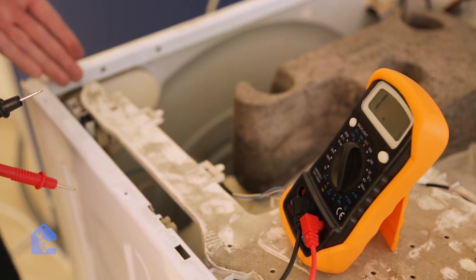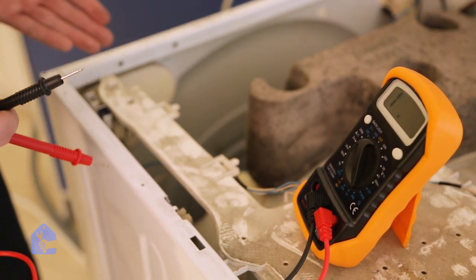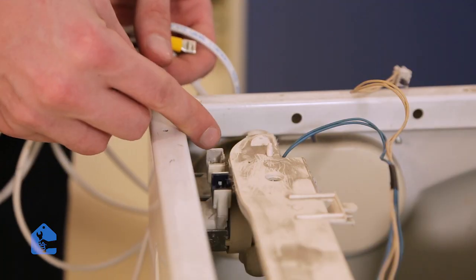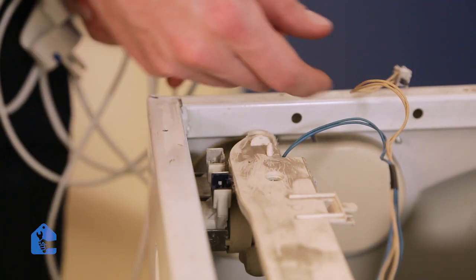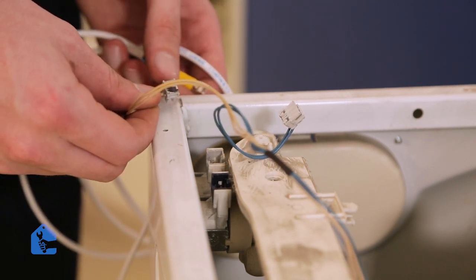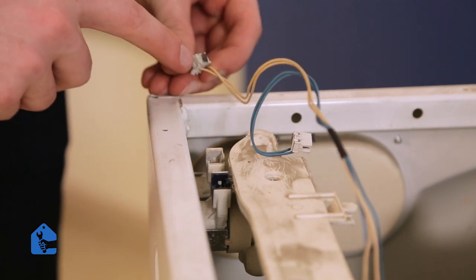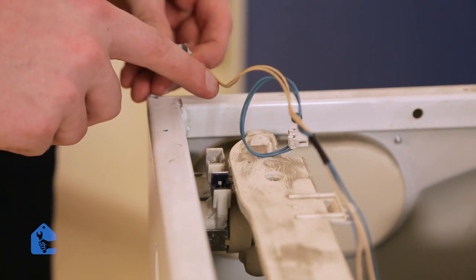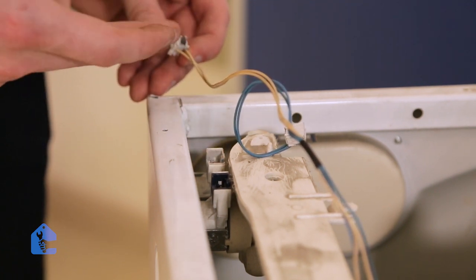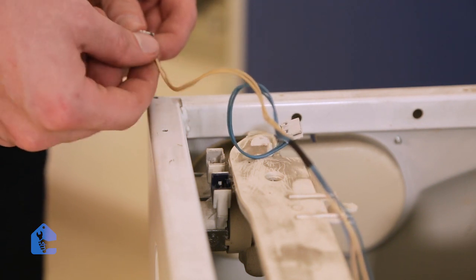Don't worry, it doesn't necessarily mean the valves are fully functional and opening fully. Just because it passed the test, it doesn't mean they're fully functional. Instead, we're gonna grab our power test wire and test the valves. But since it's using a custom harness block, we won't be able to connect with our regular connection. So instead, we're gonna reuse this wire as our power test tool and connect it to the valve. Don't try to open this harness block, it's made out of plastic and will break.